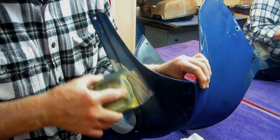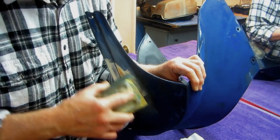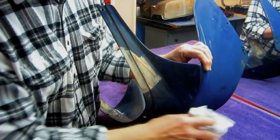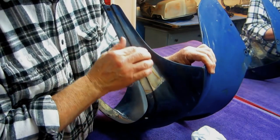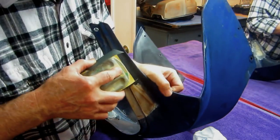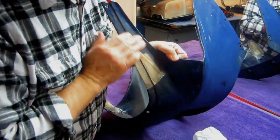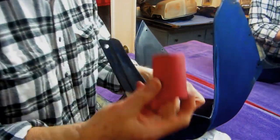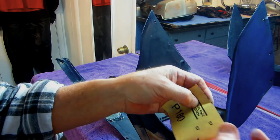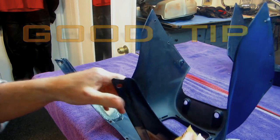Once you get the power tools done, you need to be very patient with one sanding block. Start with 120 or 180 grit, get it smooth, then replace the paper with 400 and sand that smooth. If you go through back down to wood, or feel a part that's not right, put another coat of CA on — that's the nice thing about CA, you can keep putting coat after coat and it dries instantly. Try to avoid using Kicker, just let it dry in 45 seconds to a minute. A critical thing on a repaired part: if it has any sharp edges — razor edges — the paint will eventually crack there, especially on a two-stroke bike with vibration.